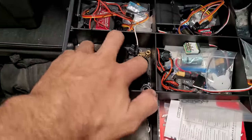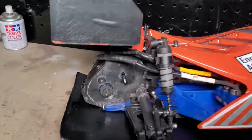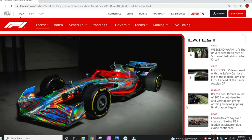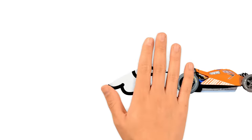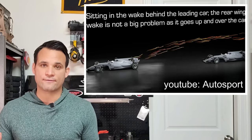This project is definitely a success, and pretty awesome considering it was done on a shoestring budget in my garage. I did take it out with higher-speed gearing to push it further, but shredded the internal gears on the transmission — the stock transmission isn't set up to handle this much torque — so until new parts come in I can't do more testing. The good news is that ground effects are coming back to F1 for the 2022 season for two main reasons: first, for a given level of downforce they're less draggy than wings.